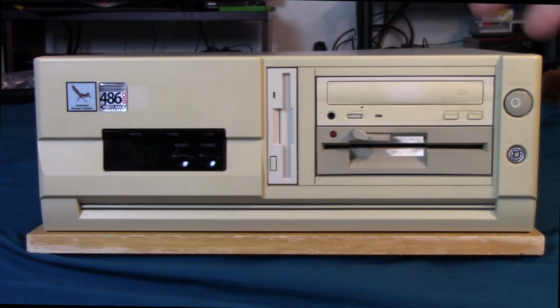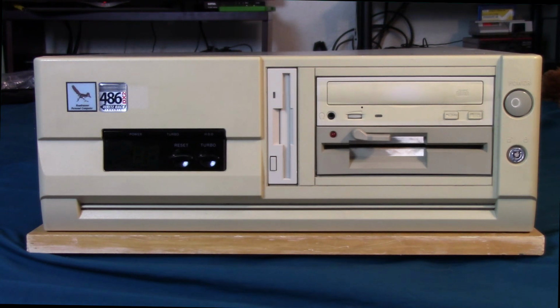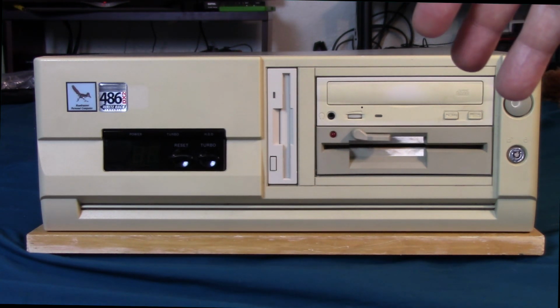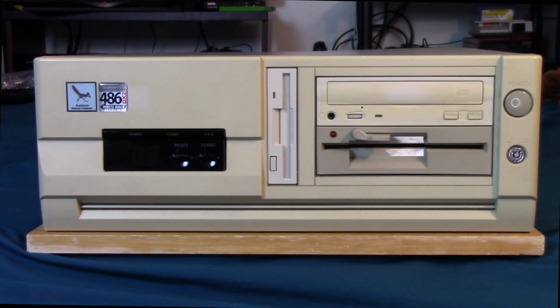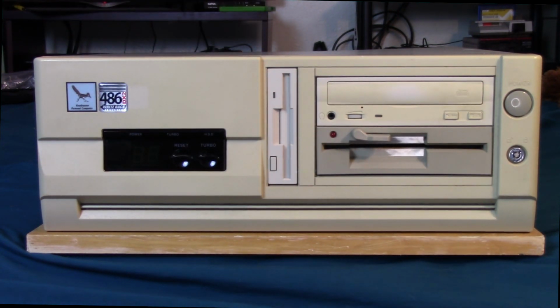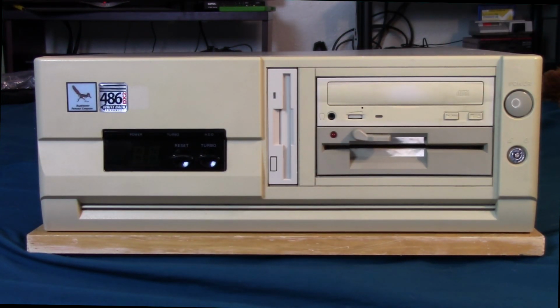There are a few downsides. I know it has some incompatibilities with certain SCSI cards and things like that. It can be slightly more temperamental, but like I said, it is a little bit faster. Generally, chips that support write back were the DX4 and up, but with Intel, there was one model of the 66 megahertz DX2 that did use write back cache, and that is what this guy is based around.